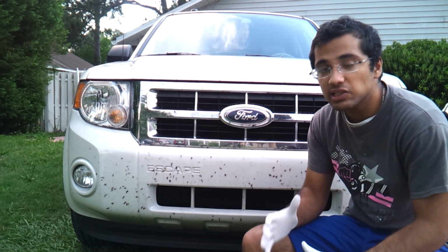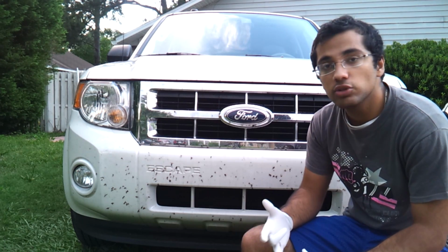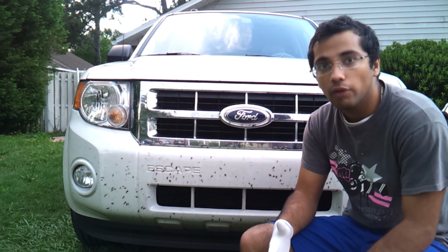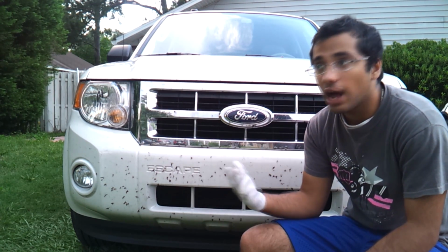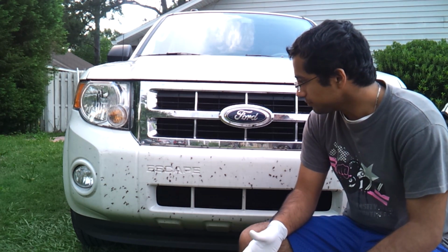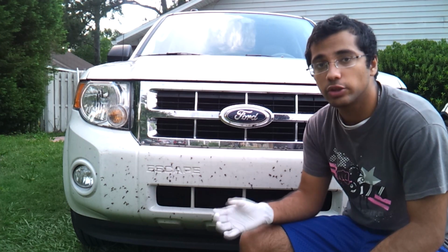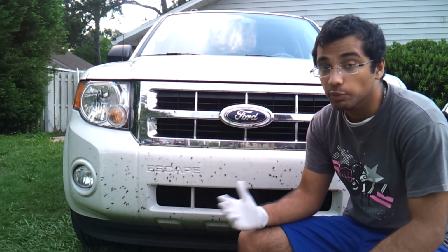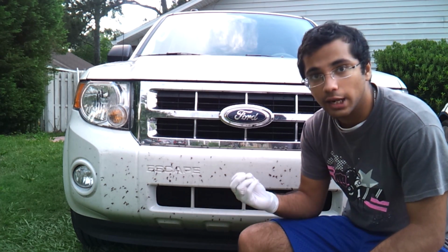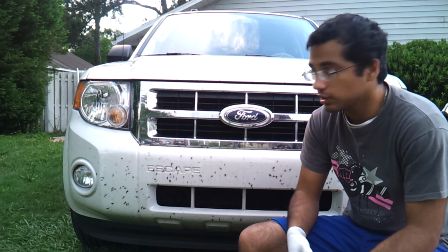The best thing you can do for your paint is, as soon as you get bugs, use a waterless wash. Like the day of, not the next day, not a week later, not a month later, and definitely not 2 months later. The reason you can use a waterless wash is because if a bug is fresh on your paint, all you need to do to remove it safely without causing scratches is simply lubricate the bug guts and then wipe it away using proper technique.